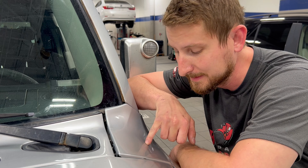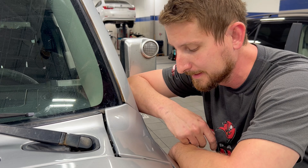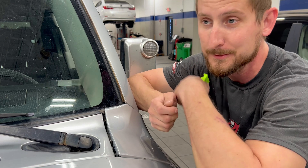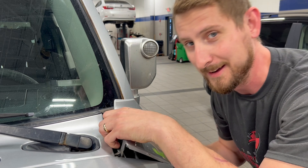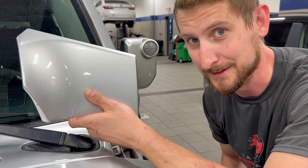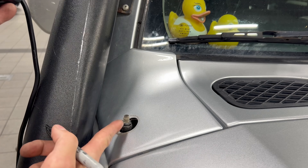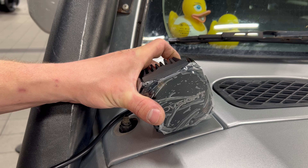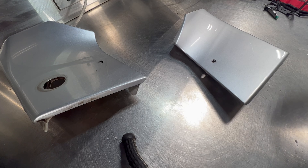Step one is to take these panels off. The clips underneath are old and brittle from years of really hard abuse. I've broken every single one under this panel — I'll need to get new ones from Toyota. In theory you're supposed to be able to just finesse it off with a nylon pry tool, starting down here and then out the top. Because we're drilling into these panels, you want to mark ahead of time and know exactly where it's going to fit. I'm doing this side first because there's an antenna there I don't want to interfere with.